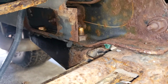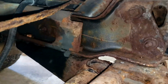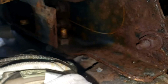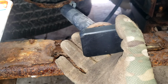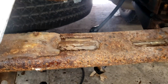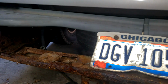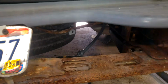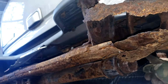And then after that, our focus moves to these bolts right here. So if you're just wanting to remove the bumper, I believe you can without removing the hitch. You'll want to remove this bolt right here. Your factory cover for the spare tire access winch comes off too. Like I said, this one's obviously in pretty rough shape, so I did not need to work very hard to remove it. To remove the bumper, we're now underneath, to give you a frame of reference here.